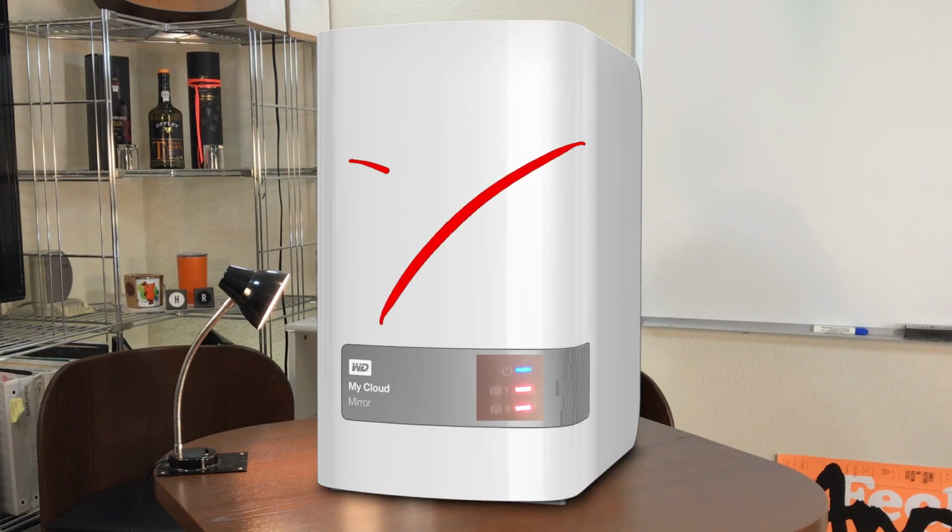So, now it became a race against time to get all the data off the other drive before it all would be lost. This is a good reminder and a perfect example that RAID is not backup, like I said before. The good news is that due to the RAID 1 configuration I had the system in, I was able to retrieve almost all of my data, but because I had to go through a now failing backplane, it took a full 3 weeks to slowly copy all of it onto other drives.